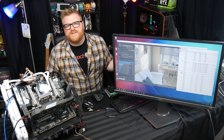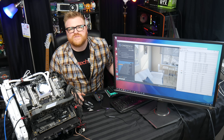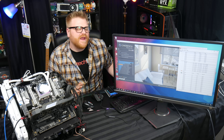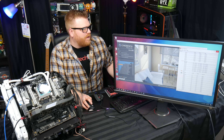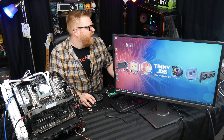Where does this CPU fit compared to the 9900K? I had the opportunity to play with that before with a very good motherboard. I was able to get it to 5.3 gigahertz with the aid of some snow. But just for stock reference, all cores run at 4.7 gigahertz on the 9900K when you turbo boost using Cinebench, and I got a 1985 — probably my Windows install wasn't great. IPC is very similar; with a 4.7 gigahertz overclock on the 7820X I'm getting around 2018.